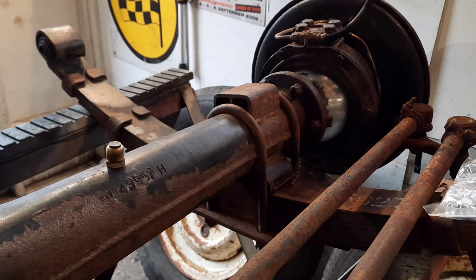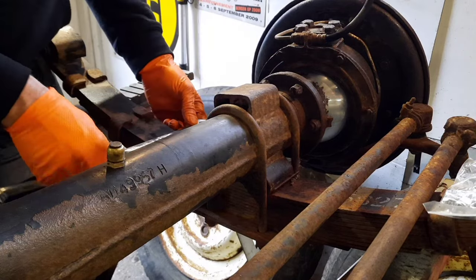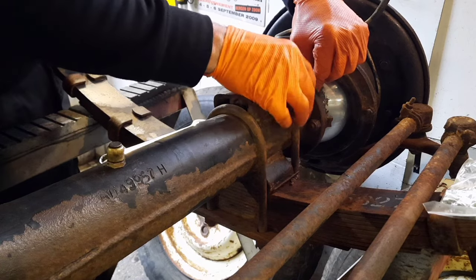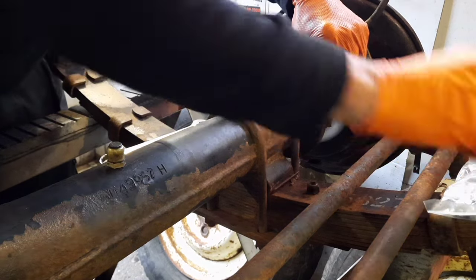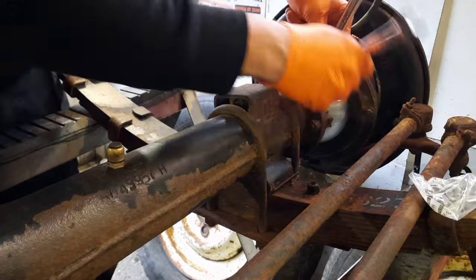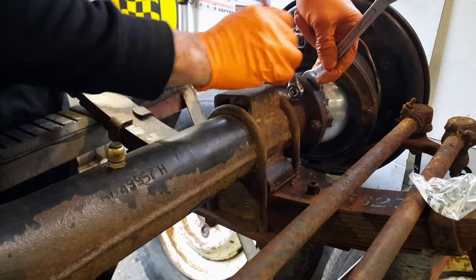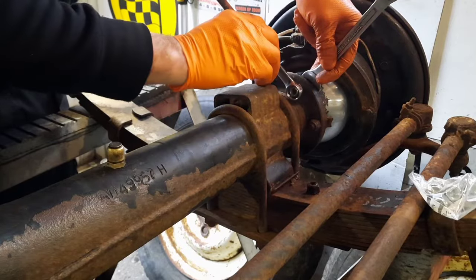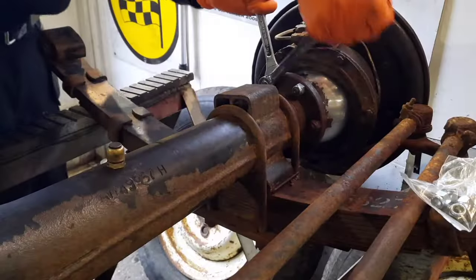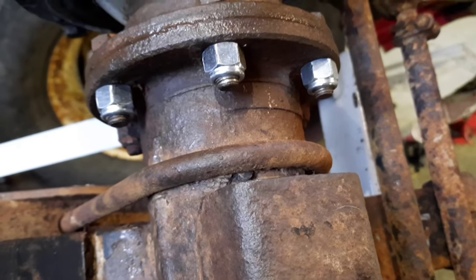So I'm going to start, I think, changing the nuts on these swivels so that at least the swivel's bolted back to the axle properly. They're 5/8 spanner size, these nuts, but as I say, I already managed to get some heat into them and free them up. So hopefully these are the right thread. I just thought I'd replace the nuts that were knackered, to try and keep the axle to a good spec and make a good job. That's the three nuts swapped over there, so they're nice and tight, so that's that bit done.